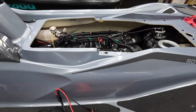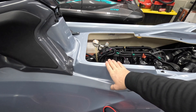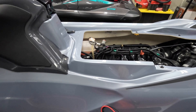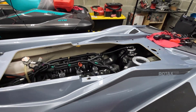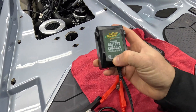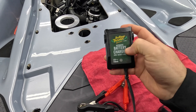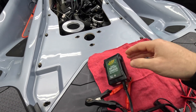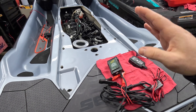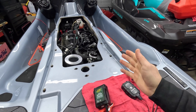The next topic is charging. On these batteries, you don't want to use a full-size automotive battery charger — you don't want to send 10, 15, 20, or 50 amps to it. You need a small trickle charge. The two biggest chargers on the market are the Battery Tender brand and the NOCO Genius. This Battery Tender puts out only 750 milliamps, and it's a charger and maintainer.